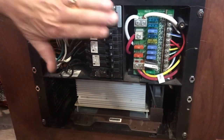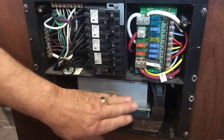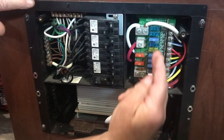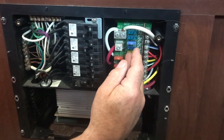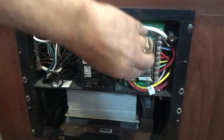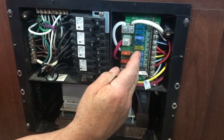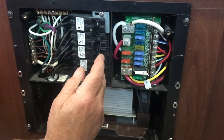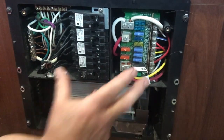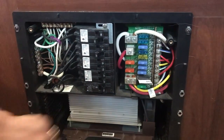The 120-volt side and the 12-volt side are nowhere tied together except through the battery charger. If you take the wires off, they're not connected at all. All your lights, your fridge, your hot water tank — all that comes through on the 12-volt side. If you have a 120-volt hot water heater, it comes off the 120 side. Turning the 12-volt on does not turn on the 120, and turning the 120 on doesn't turn on the 12-volt — they are totally two separate systems, and the only thing that connects them is when you plug in shore power.